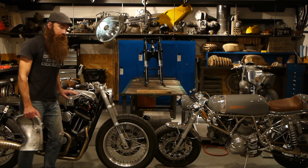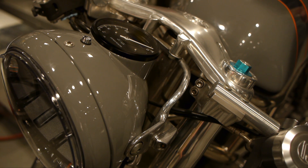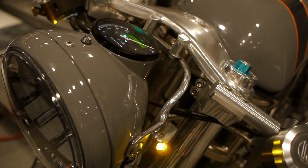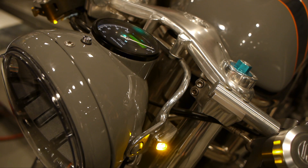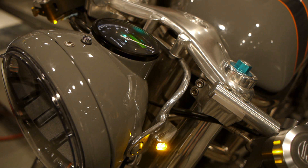Let's take a look at Pyro and see some of the lighting options the M-Unit has. Start by turning this on. Now you'll notice when we turn it on the headlight is out but the running lights have come on. The running lights are programmable — you can set how bright they are, whether they operate as running lights. Of course these are also the turn signals, and if I want a brief flash like I was changing lanes, a quick tap and the turn signals will flash three times and then go out. If I press and hold a little longer they'll stay on until I cancel them.